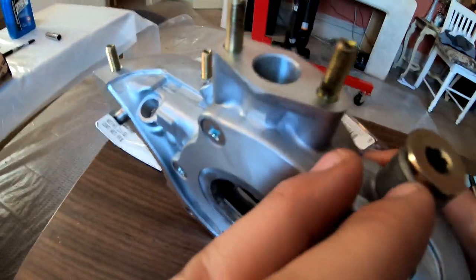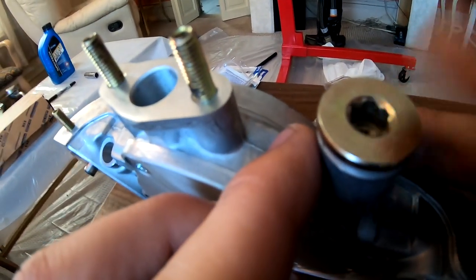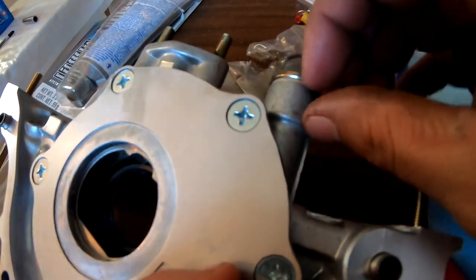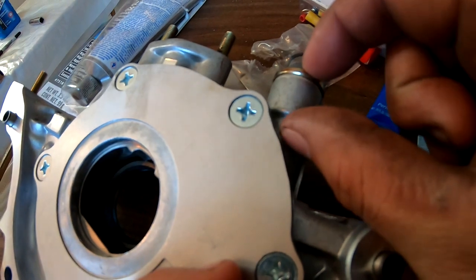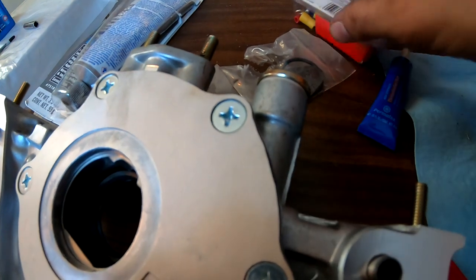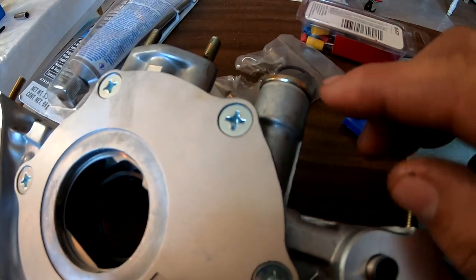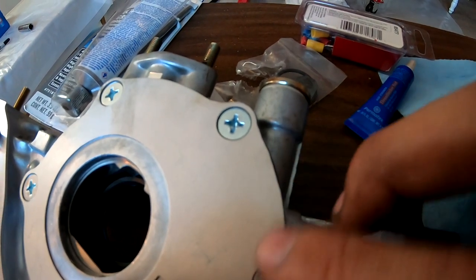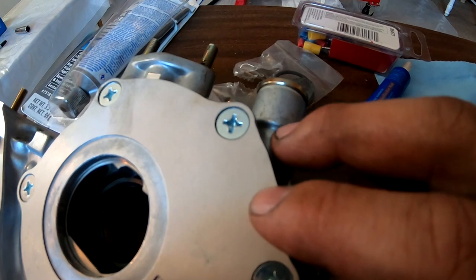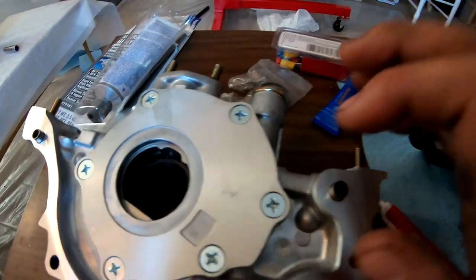How I'm going to do it is just the easy way — basically take this bolt out. It's kind of like about this big and it looks kind of like a little piston. Then try to place a shim on top of that little piston. That little piston connects to a spring, and that's what we're going to try to increase the tension on — the spring — because the harder the spring, the more flow you'll get through there.